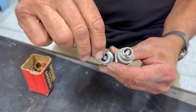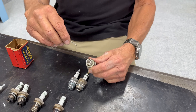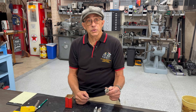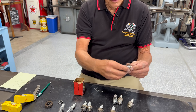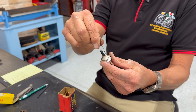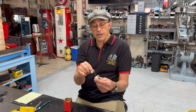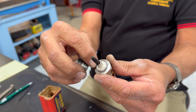A hot plug — see how far this paper clip goes in there? And on this one, how far the paper clip goes? So here's another plug that looks like these, but the paper clip only goes in a tiny bit. The depth behind the insulator underneath there indicates the temperature range of the plug. A hot plug has the porcelain not insulated by the jacket of the spark plug. The problem with a cold plug is that wherever the metal widens inside, that's the limit of how far you can machine it down, because otherwise the metal goes away very quickly — it's tapered in there. So once you get to where it gets wide, you can't do any more machining.